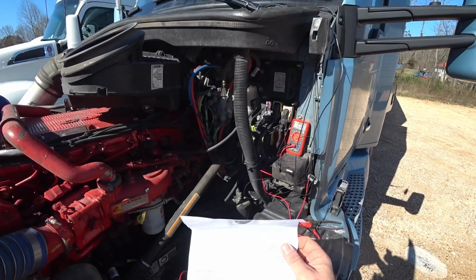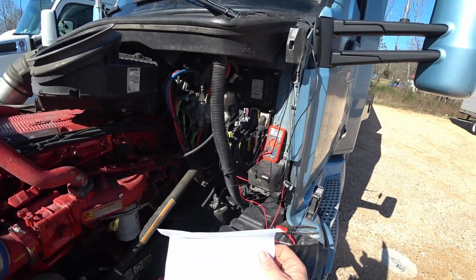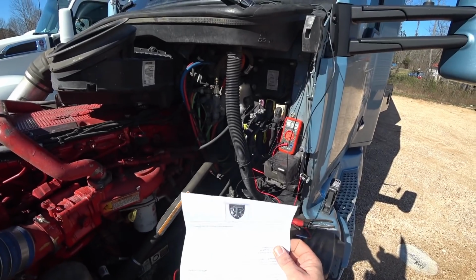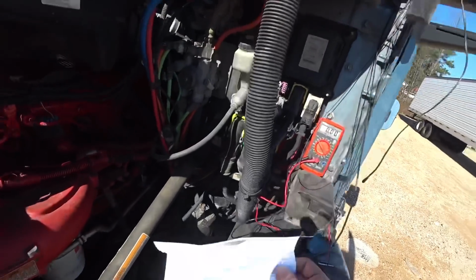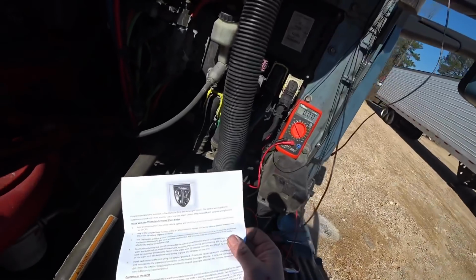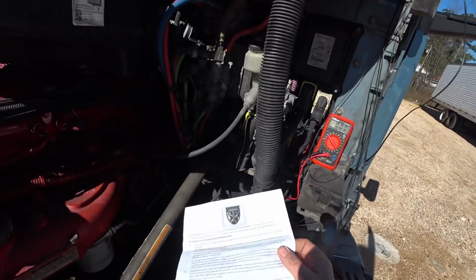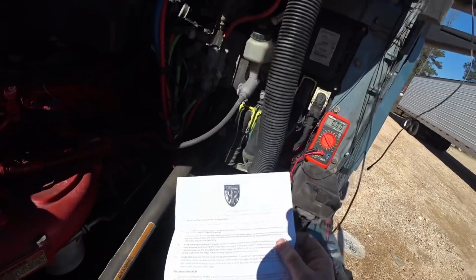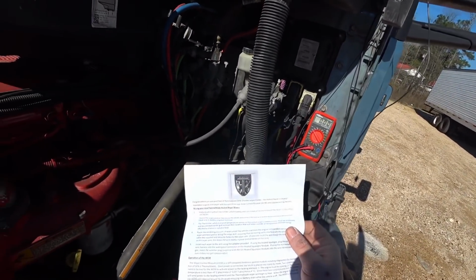Once the two connections are made, they will send power to the heating element and the thermal wiper blade will begin to heat. When the engine is shut off, the WCM will interrupt power to the wiper, ensuring no battery drain while the vehicle is off. The WCM is independent from the vehicle's computer system to ensure universal fit for any 12-volt vehicle. But here it is.